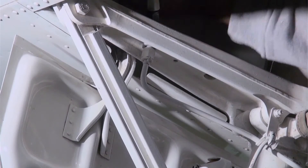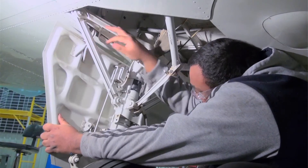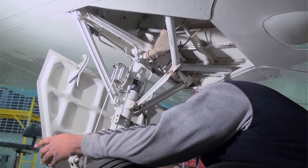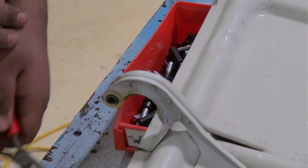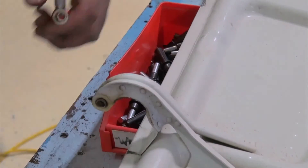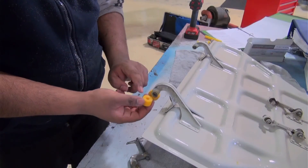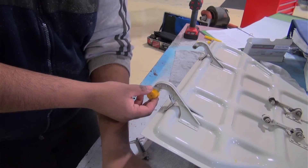Andrew has removed the nut and the bolt from the forward hinge. Once the aft bolt is removed, the door can be dismounted. The steel OEM bushings are removed from the forward hinge, one from each side. We will need to push out the outer steel bushings before fitting AeroTuff. A polymer spacer is fitted between the two hinge arms to keep them from being bent as the old bushes are pressed out.